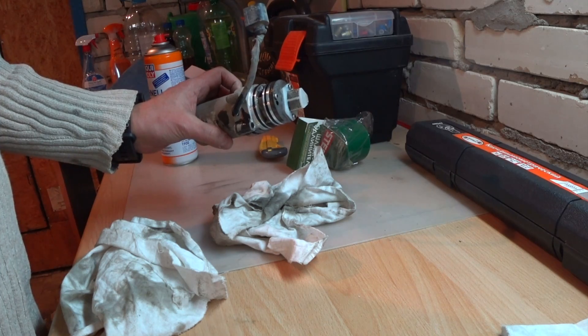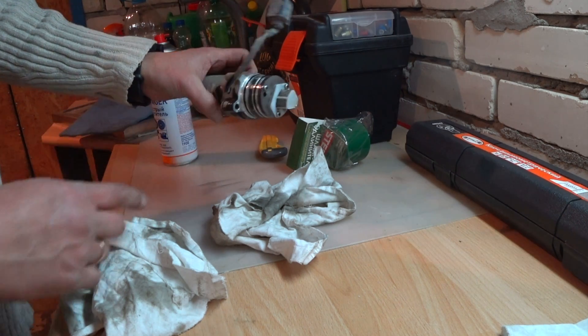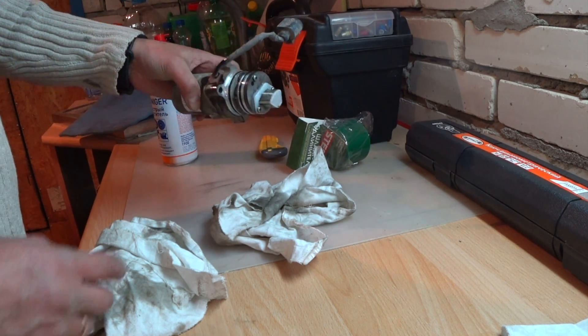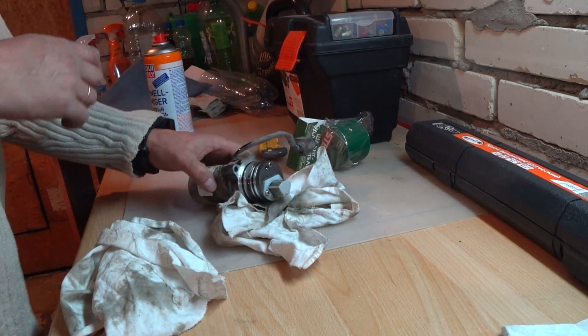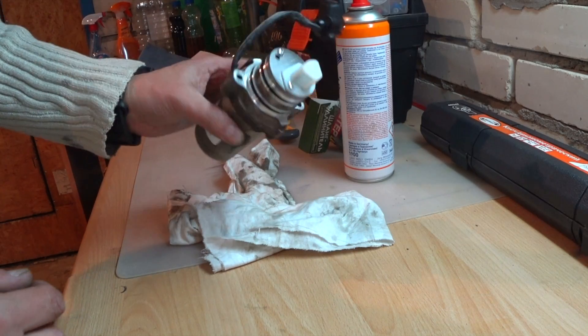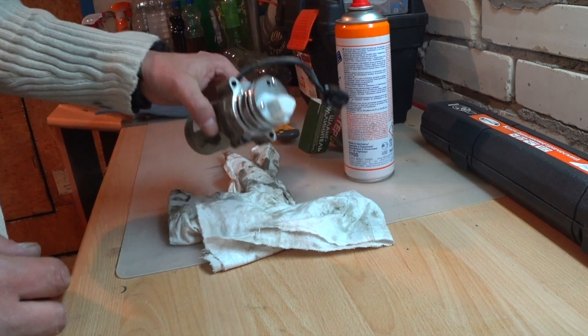This is now the third time this Volvo gets an oil change in the Haldex. If we look at the sock, it's in pretty good condition — not too much debris blocking it, though the oil is still kind of dirty. Use some brake cleaner to clean it off really well. Once clean it should look like this — like brand new, with no debris.